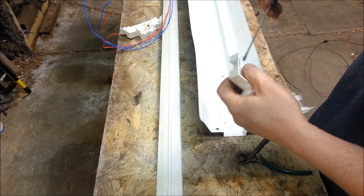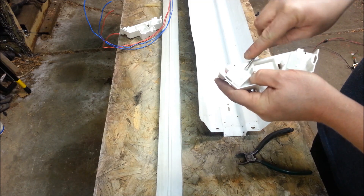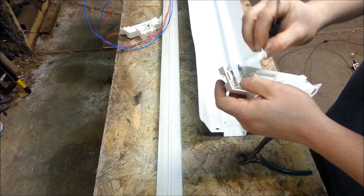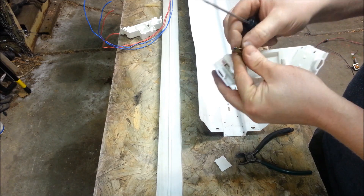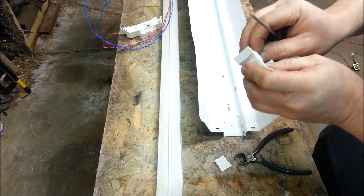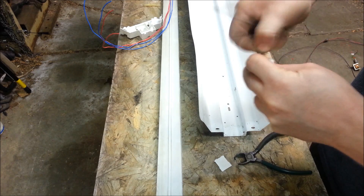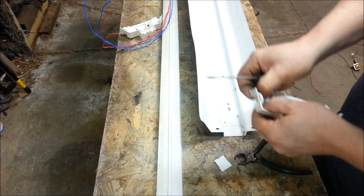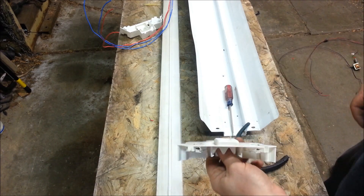We'll make this so we can just push the wires back in — almost like those, if you ever wired an electrical outlet, the outlets just have the little push-in tabs, and I like that. It's going to break off the little plastic — yep, broke those off. I did the other side in it, so I'll just plastic weld that on there real fast. I'll just pull out this little retainer, and I'll swap it over to the new side so I can just slide my new wire in there. Just took the soldering iron real fast, just tack welded this little cap back in place.